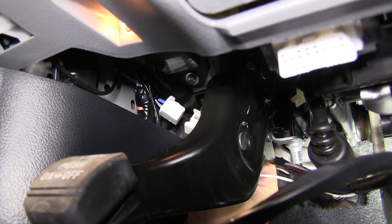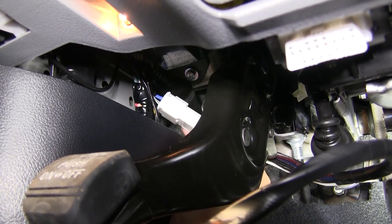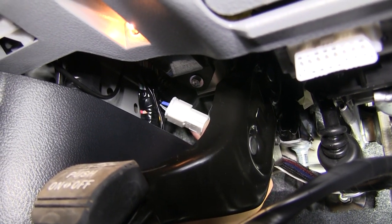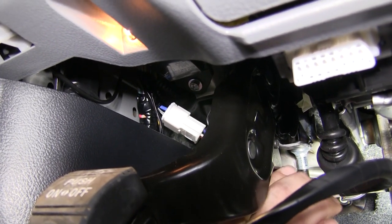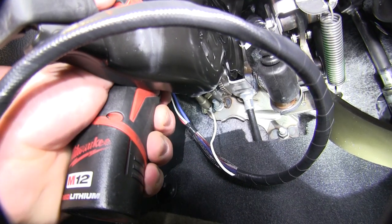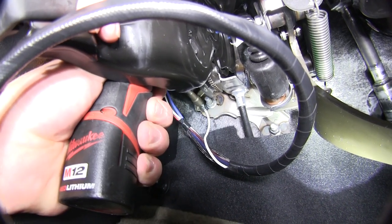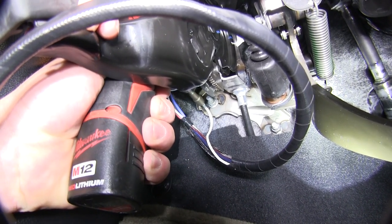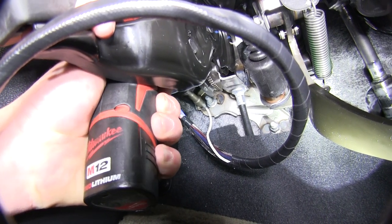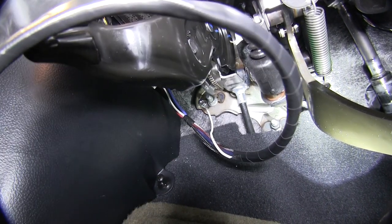Now with the tape up, we'll go ahead and take the white connector and plug it into the manufacturer's towing port, located on the driver's side just above the kick panel in between it and the parking brake pedal. Now with that connection made, we'll take the white wire with the pre-attached ring terminal — which is the ground wire for our harness — and secure it to a body ground. The parking brake pedal bracket is grounded, so we can use a self-tapping screw and secure it directly to that.